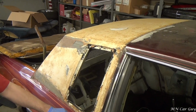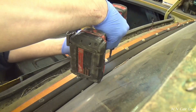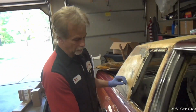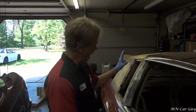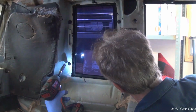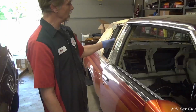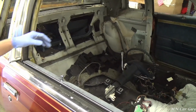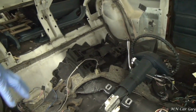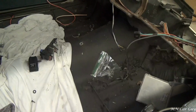It was fun to see that they screwed the trim on with these hilarious gold style screws, and that was real nice because they had buttons or snaps similar to what you'd find on your jeans, but nothing to snap over it. We also removed the opera glass windows here. We noticed that the seal was not done right after they did the tinting of the window and reinstall along with their interior changeover. It didn't seal right, and there's evidence of the rust that was present down on this floor thing, but we coated it with an undercoating product prior to wanting to seal it.